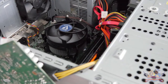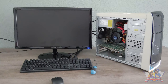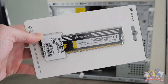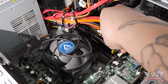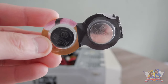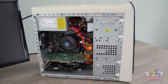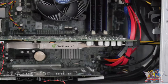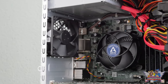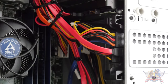I tried my luck again with the RAM modules, figuring maybe one of them might be broken, so I tested each module one by one — but with no luck at all. So I ordered a new RAM module, placed it in, and replaced the CMOS battery again with some other fresh ones — but it gave me the same two beeps right from the start. After reading message boards on the internet, the other common problem indicated was that the motherboard might be defective.